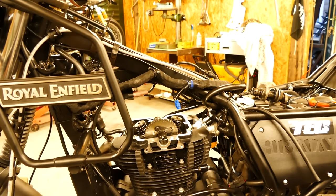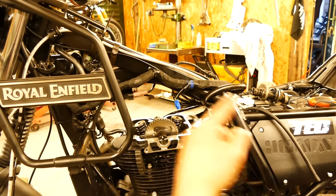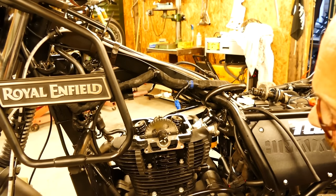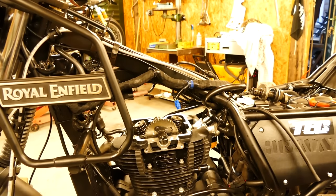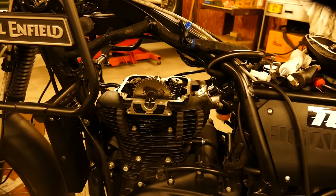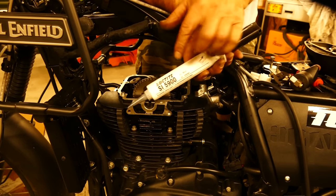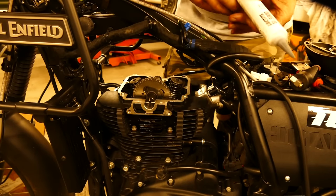For peace of mind, once you've got the cam chain tensioner in, take it through a full cycle and check again — it's no harm to keep checking your cam timing is absolutely right. Every time you turn it, never turn it back because that releases the cam chain adjuster — always turn it anti-clockwise and go through two full turns until you come back to your T mark. Check the hole again — it should be spot on. Always worth checking again with the full tension on the cam chain just to be sure. Now clean off all the old gasket from the head. We're using Loctite Silicone 5900 as Royal Enfield recommends — it comes in gray from Royal Enfield but I could only get it in black. Apply a very thin bead all the way around.